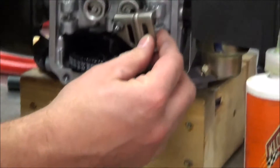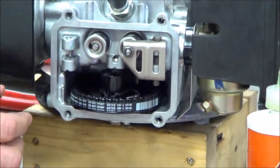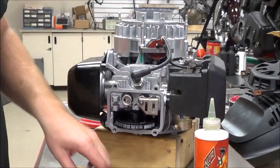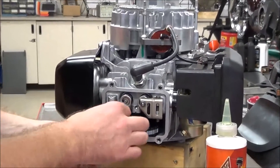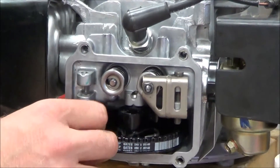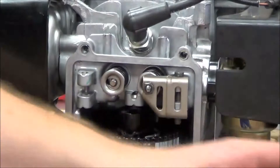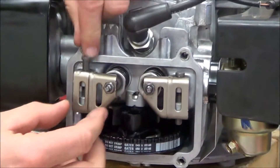These have already been identified as their appropriate intake and exhaust. There's a lot going on here in the design of this. I'm going to line up my arrow here, line up the cam timing, just double-checking things. The direction of these pins really matters. When the cam pulley is already in place, you can't put it in the wrong way — it wants to hit the cam. You could force it, but it doesn't want to work easy. When these are in the right place, they slide really nice down and into place.